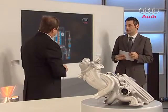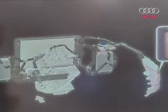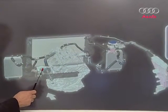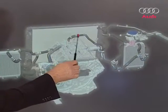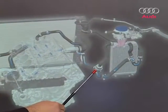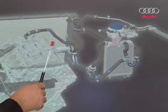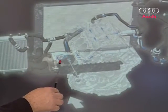We have five coolers — let's go through how things work when the engine is cold. Here is a topside view from the driver's side looking towards the front. You can see the engine and the coolant pump, which pumps the water circuit through the engine. The coolant is fed to the right towards the right-hand auxiliary radiator. Here we can see the auxiliary thermostat for the auxiliary water cooler. It goes around the cooler and then flows into the cooler. Coolant flows simultaneously from the inner V back into the coolant pump, and the thermostat creates a small circuit.